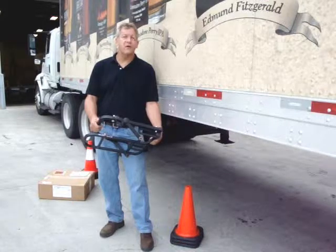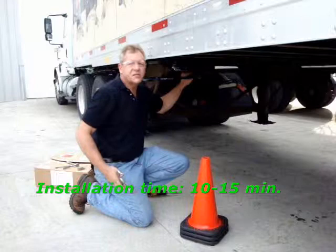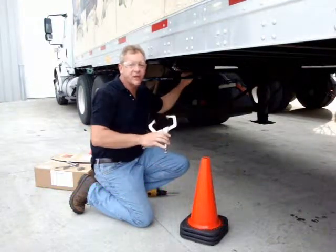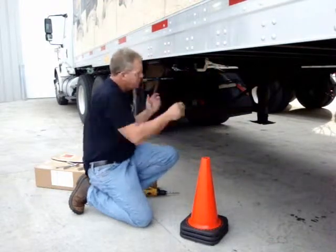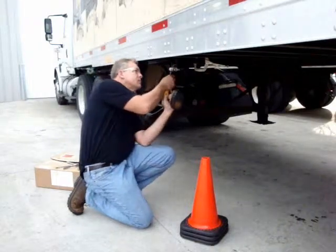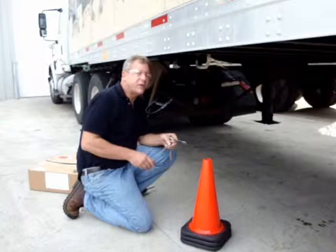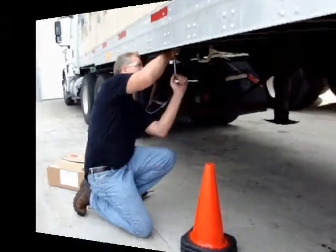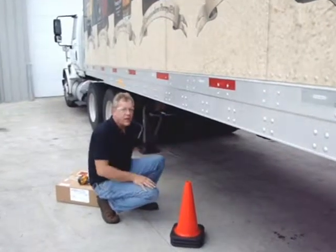The HTS CC Cone Cradle fits tractor trailers and straight trucks. Installation is fast and easy. Simply align the HTS to the floor joists of the box truck or trailer, clamp the HTS to the floor joists, open the unit, and drill the holes. After drilling all four holes, simply install the three-eighths fasteners that came with the kit. Once the bolts are tight, you're ready to go.